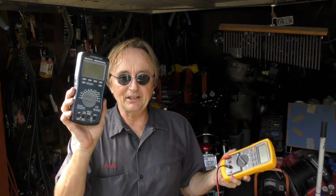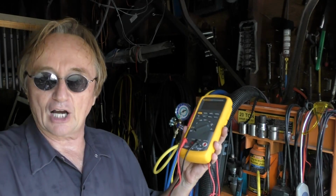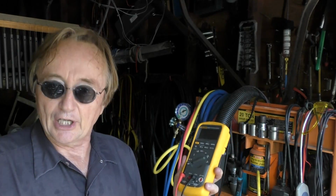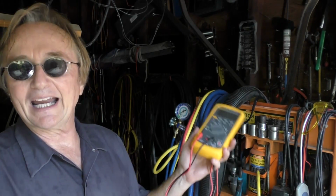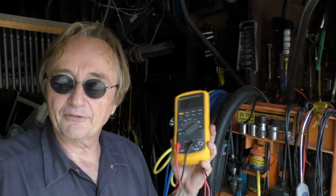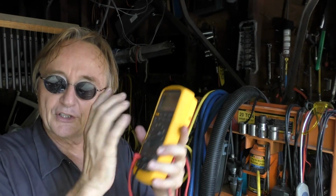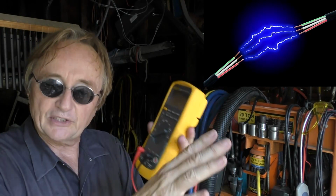But as a warning for those who might own a hybrid car and want to work on those electronics, you can't use this one. Heck, you can't even use my $550 one for a lot of that stuff. The hybrid ones use really low power electricity for some of the stuff and really high power for the other, so you need a gauge that costs well over $1,500 because they're going for milliamps and then for mega amps. So you need something that's super expensive. Plus, you really don't want to work on a hybrid car unless you're a professional electrician or a mechanic trained on them, because you can kill yourself with that high voltage. You have to get voltage-rated gloves and check them before you put them on so it doesn't arc through the glove and electrocute you. That's stuff that's better left to pros.